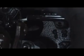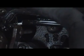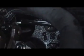Now in the manual it tells you to go ahead and see that little bolt right there. Let me see if I can point to it. That guy right there, it's a little Allen bolt. They say to go ahead and unbolt that. There's two of them. There's one in the front of the head, and there's one right about right here, just in front of your back injector, and it recommends you go ahead and take those out to drain the rails.